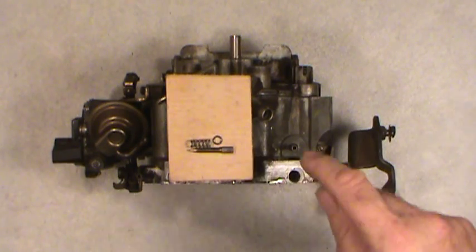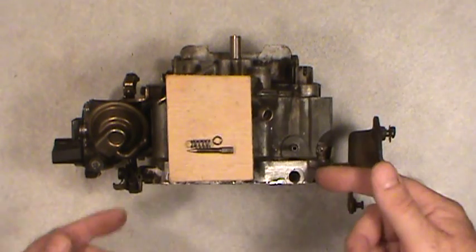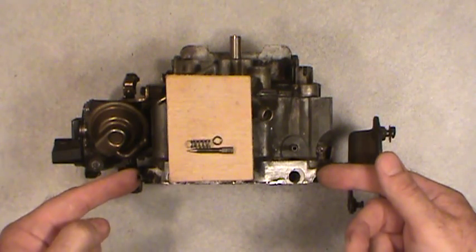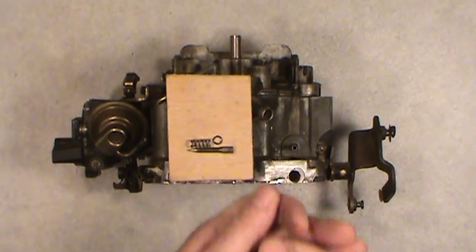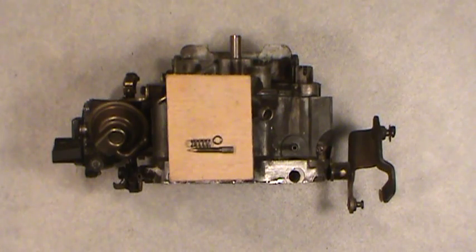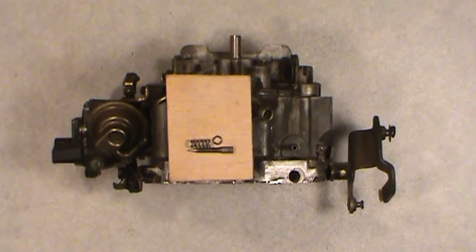So that's when I came up with this little do-it-yourself idle mixture adjusting screw copper tubing hexagonal socket extension, if you will. How's that for a mouthful of words? I actually got them out in one shot. So that's what you're faced with there. There are two sets of these — one goes in here, one goes in here. The washer goes onto the threaded portion of the idle mixture screw with the spring following. To put them back in, spring goes in first. You can assemble this and put it in. This carburetor is in the vertical plane for the video — normally it would be laying flat on a bench, so gravity wouldn't be working against you. One per side — that's what you have.